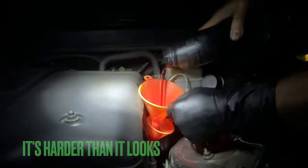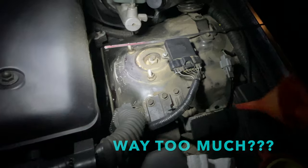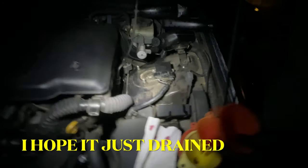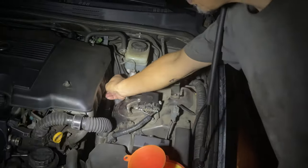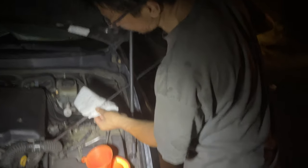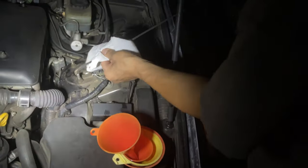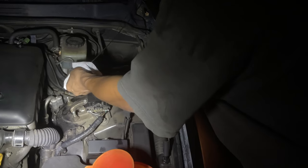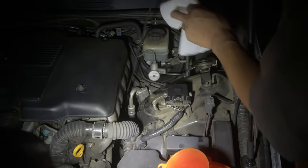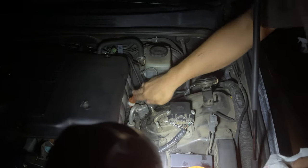I bet it's because it drained out. I'm going to let it run because it might pump through some systems. I think because I refilled the pan, so much drifted out of the body — that's why it's reading so high. It's reading really, really high. It should be way down here. So I'm going to run the engine and then we're going to check for leaks. It's been an hour and about 20 minutes. We're supposed to wait one to two hours before we start the engine. So hopefully it's enough — and it's a 15 to 16 hour cure time before I can actually drive it and put pressure on the transmission.